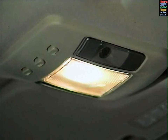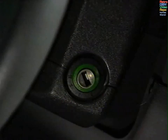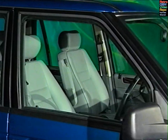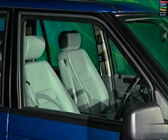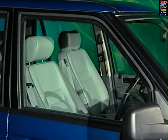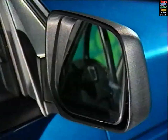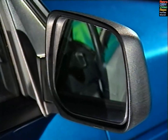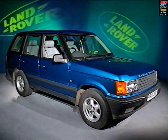The BeCM switches on the interior lights and ignition key barrel illumination. Where available, it instructs the seat to adjust itself to the memory position which corresponds to the handset being used. In the same way, it sets the mirrors to the required memory position. It instructs the security portion to release the doors and superlocks. The perimetric and volumetric alarm sensing are also disabled.